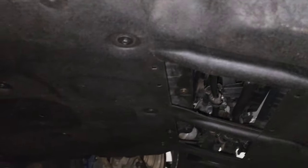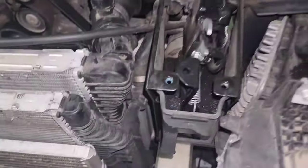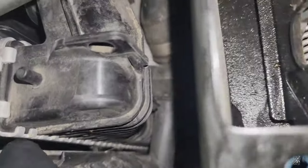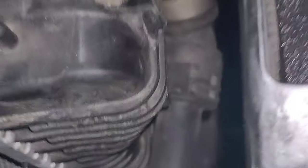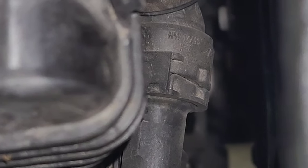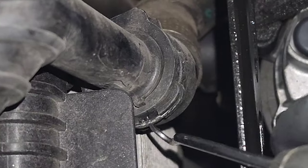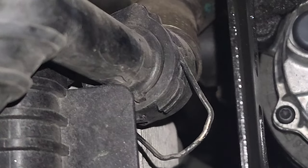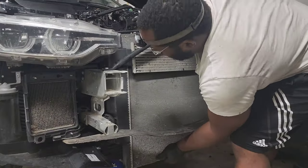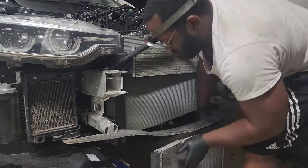Under the car we're going to remove the belly pan — it has a bunch of eight-millimeter screws scattered all around, so remove all of those to get the belly pan out of the way. Then we're going to disconnect the coolant hoses attached to the heat exchanger. To drain the coolant you want to remove the one on the passenger side because it's lower, but I'll show the driver's side since it's easier to see. There's a small metal clip — use a hook pick to pull it down, which releases the coolant hose. At that point you can pull it out and the heat exchanger drops down through the bottom and out from behind the transmission cooler.